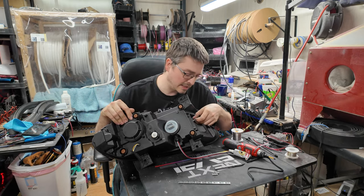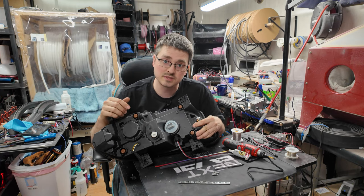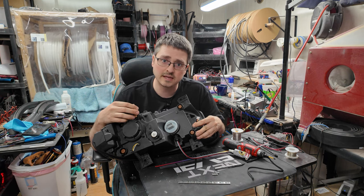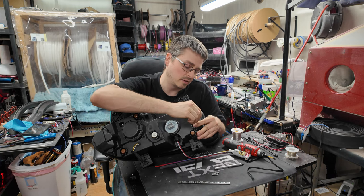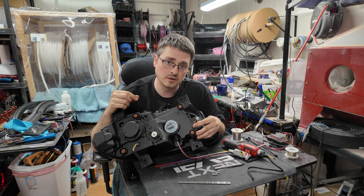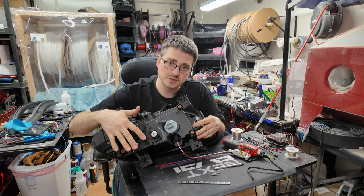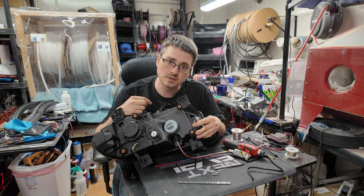So in the case of this light here, I have already tested, being that it was an LED light, I was able to just probe several pins on the back of this plug here just to verify and make sure that I had the right connection. And it does appear that the yellow wire on this connection is your turn signal and the red wire is your DRL connection. The white wire goes to these plugs up here, so I'm not actually going to use that. But in the case of this one here, we are going to use the red and we are going to use the yellow.